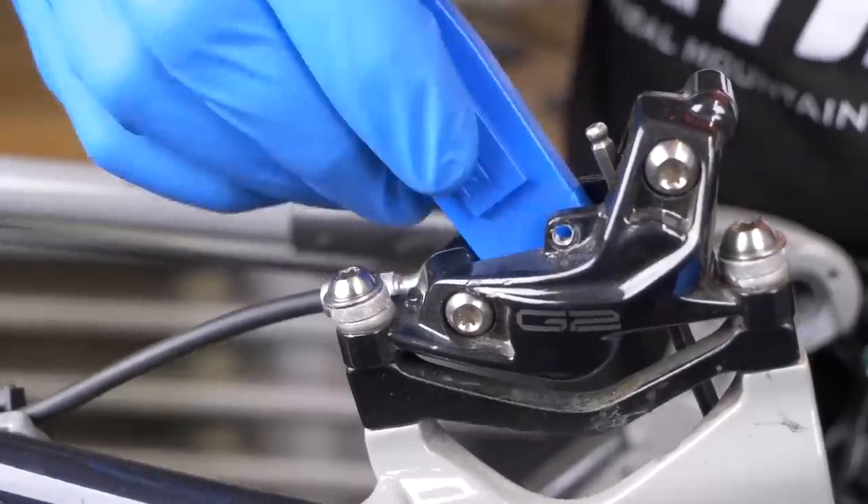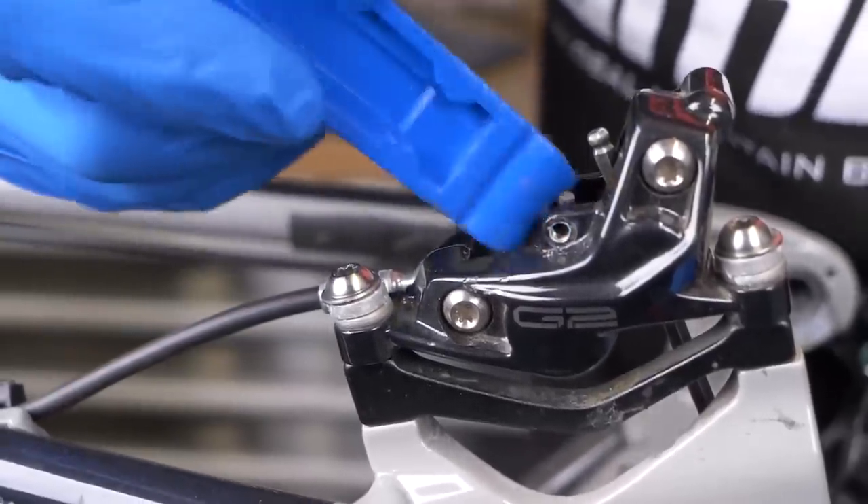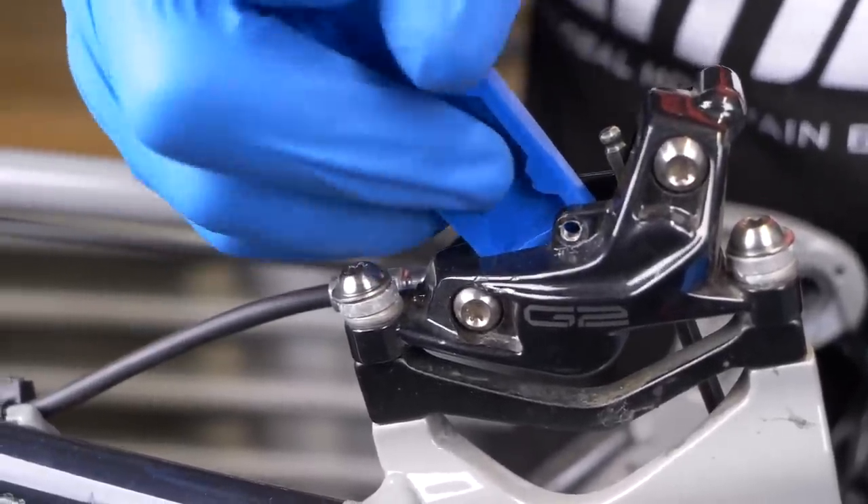Retract them back into the housing. Use some isopropyl alcohol or disc brake cleaner to make sure there's nothing left on the caliper — especially important if your bike has DOT fluid since it will take paint off if left on the bike. Clean it all, put your pads back in, give the lever a feel, and hopefully they will retract and the dragging will stop. You might also find in doing this that you've identified the need to bleed the system. If so, pads out, bleed block in, and bleed them in the relevant way. We've got loads of videos about brake bleeding on the channel — I'll throw them all down in the description.